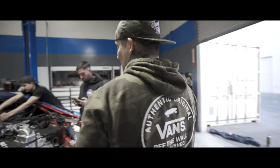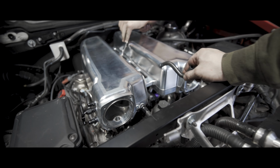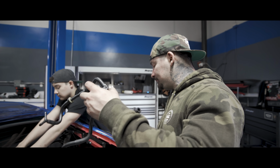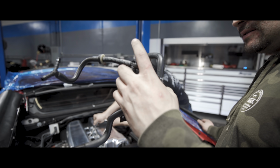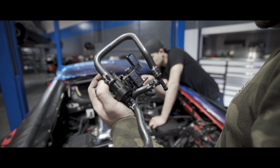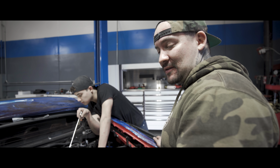This intake manifold that we have relocates the fuel rails to the inside. If you look in there, the fuel rails are on the inside. Factory, they're on the outside, meaning it allows all that room in there for all this stuff. However, with the fuel rails on the inside, all this has to be relocated. We still keep this for emissions reasons. So I just keep one, and with Motec, we're able to control the canister fumes off of one solenoid versus having two.